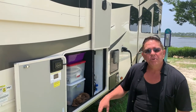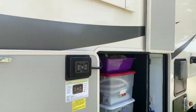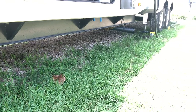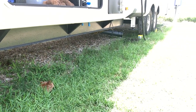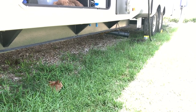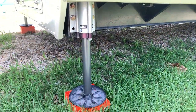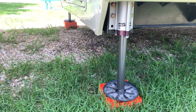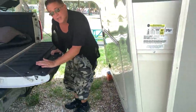So let's go ahead and push the hitch height button. And here we go. So as you can see, the jacks in the back are lifting. Usually the middle ones go up first. Now the back ones are going up. And then the front might adjust just a little bit more. But nope, we're good. So awesome. So at this point, we should be aligned